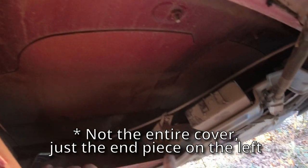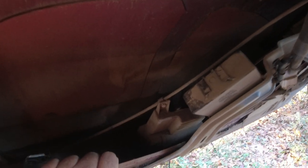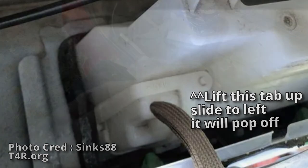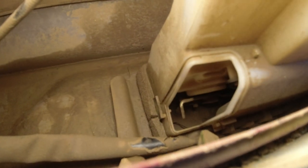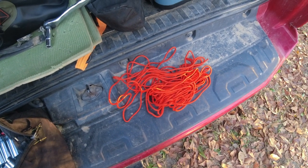Now that the cover is off and the plastic is off, what we're going to do is take this plastic cover off right here, and this plastic cover is going to be covering up the hatch itself. Go ahead and get this plastic cover off. Once you get this little plastic piece off you can see that little lever right there, and that little lever is what controls the hatch. That little lever is what we're going to be attaching the pull cable to.